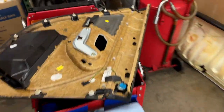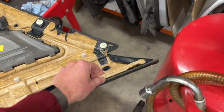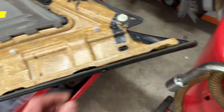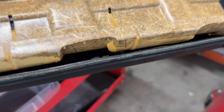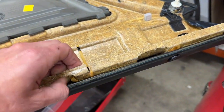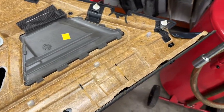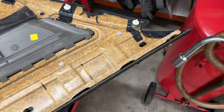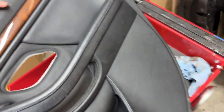The other one's over here. I don't have enough clamps to have them both go overnight. This glue — it's one of the newer sets we've seen, being an 03 — but it's coming off in tiny little pieces. Usually it's still kind of stretchy and you can grab it and pull it off in chunks. Not the case here; it's all just flaking apart. This car spent the majority of its life outside, and that certainly shows.